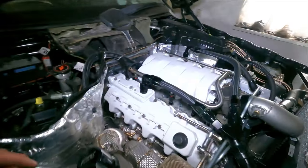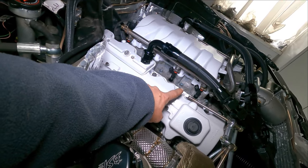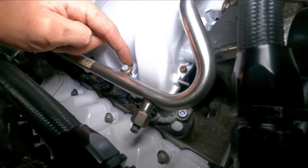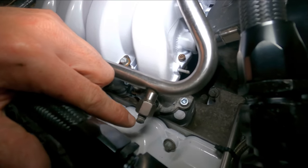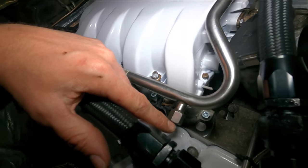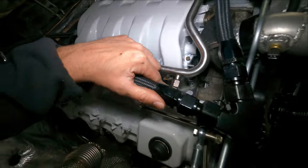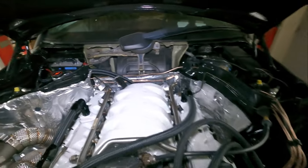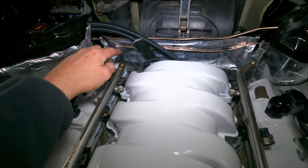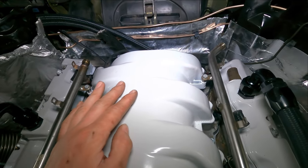For people who didn't see it yet - I mentioned it about two videos back - I have the new injectors in. They are 1100cc. They are a little bit higher, so I have some adapters underneath the original fuel rail connection. This one is welded shut - it was normally the inlet. This is normally a non-return fuel system so you only have a feed line. There is an AN8 connection welded on here and over there, so it doesn't make any difference which side I use as the feed and which as the return.